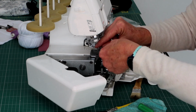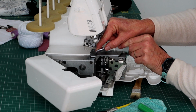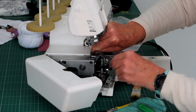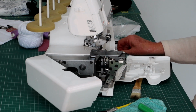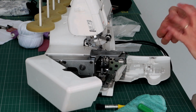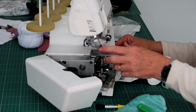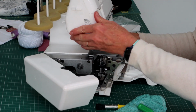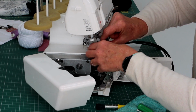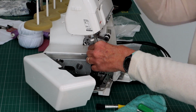You wash off some of the parts. The gears get opened, and the motor gets put into a bath to clean out the carbon build-up. So there are lots of different things that happen to it. We check for wear, so we can warn you that by the next time you're getting serviced, your gear is worn or your motor pulley looks like it's giving in. So at least you can save up a little bit as well. It's basically just like your car: you can do the oil and the tires and everything else, but it's got to go in for that extra tender loving care.